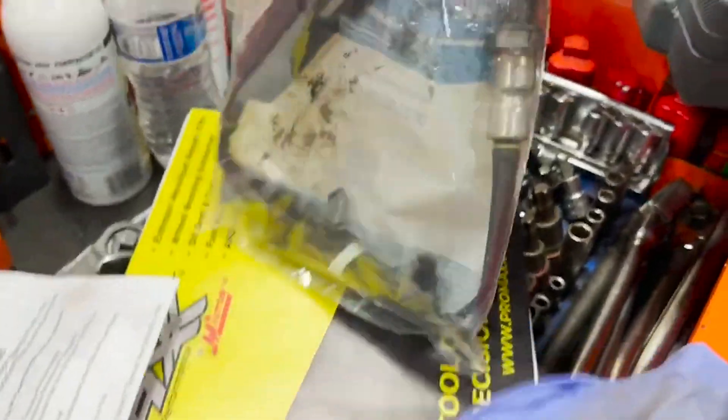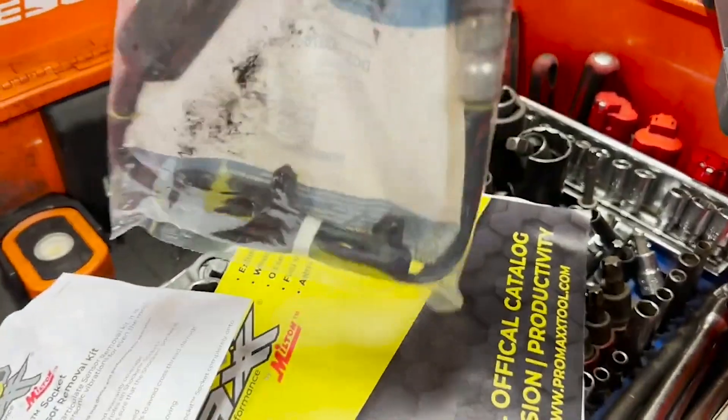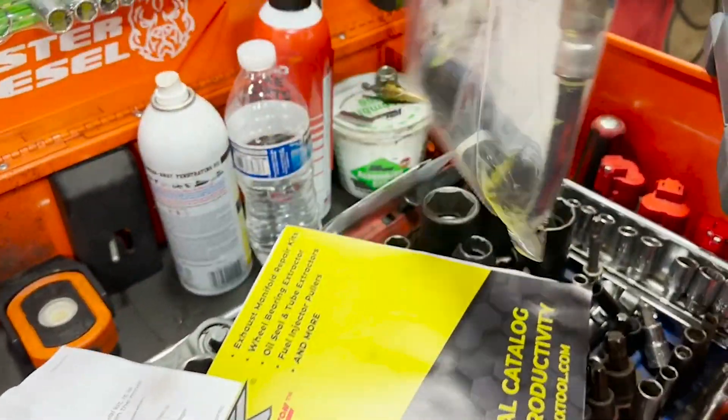20EE for a Super Duty, 207F for the steel body trucks. What I am suspecting right now is that we have a lazy NOx sensor. It's like an oxygen sensor, but it's not reading the oxygen content in the exhaust — it's reading the oxides of nitrogen. And if it does not read correctly, we're going to get the check engine light on and it's just going to cause us a bunch of havoc.